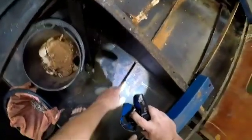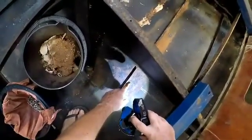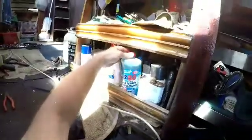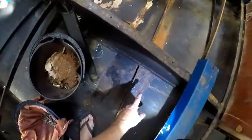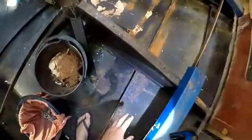And you know, I've got some of this B50 salt remover cleaner. So after I degrease wash it, I'm going to give it a lap with that, and hopefully I'll be able to dissolve all the salt out of the steel before I hit it with the phosphoric acid rust converter and then prime it. So you know, there is a bit of a process to be followed here.